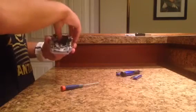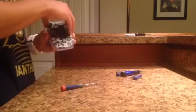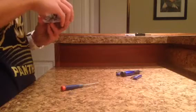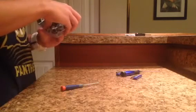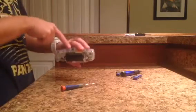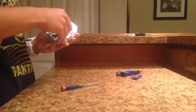So after you get those two screws out, you take what's known as the motherboard, or basically the brain, and you kind of lift it up. Now I'm trying to see if this is screwed or connected anywhere else before I snap this thing in half. It does seem like it's kind of not giving way up top here, but there's not really any screws I'm missing. Alright, if yours isn't really giving way, it's probably either clipped in place somewhere, or you're having trouble because of this plug that's up here, so you want to kind of lift up by the plug at the same time. And it's going to take some wiggling all the way around the whole thing to get it out.